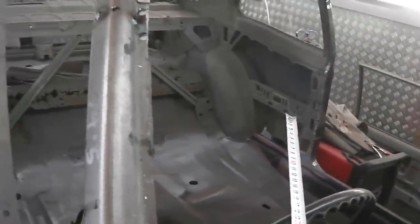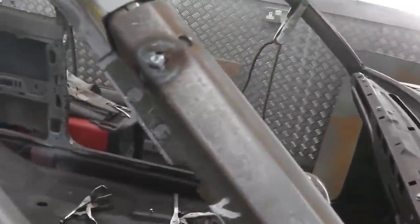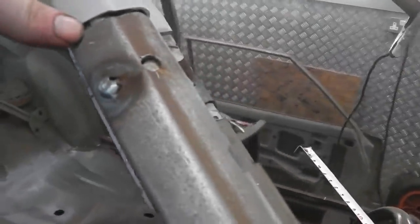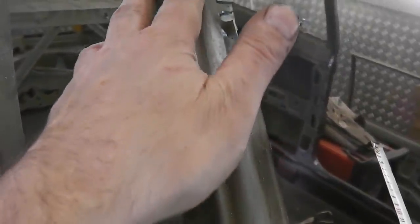And we go and double check on another Cortina, make sure it's that size. And we go and find another aperture and we measure that and make sure we've got the right windscreen aperture size. Then we also look for our measurements down and we tweak around till we do that final weld there. You'll see the profile mismatch now. Okay, on the pillar, which is the important bit, and there. Your mismatch occurs here where the profile, slightly to accommodate the different rubbers, changes. So what you do, just slit down that one and knock it in, then seam weld that up, and that'll match that profile. It's not mega important because the rubber would cover it, but may as well get it exactly right, okay? So the main thing is that profile matches, okay, there.